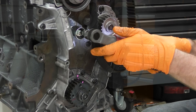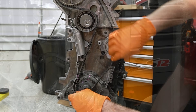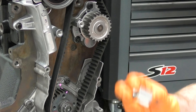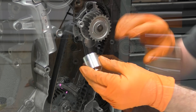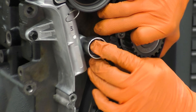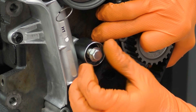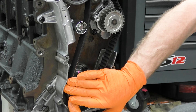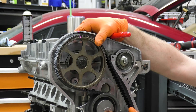Let's go ahead and take this roller off so I can show you what it looks like, because a lot of times you really do have to do that. Now we can put it on the water pump - there we go. We've got to put our roller back on. If you take this off, put some Loctite on the back side and make sure you get it good and tight. Pull the belt away a bit when putting this on and thread it in by hand so you don't cross-thread your tensioner. Make sure your belt is all the way on - literally put your hand on the belt on each gear and make sure it's fully seated.